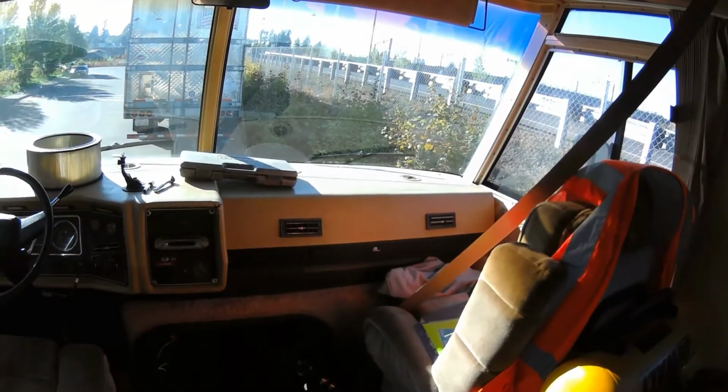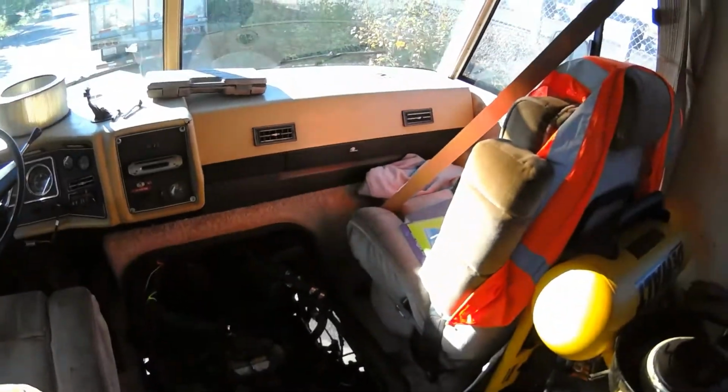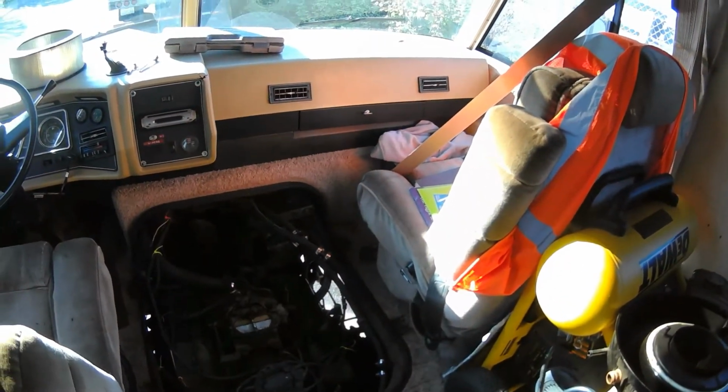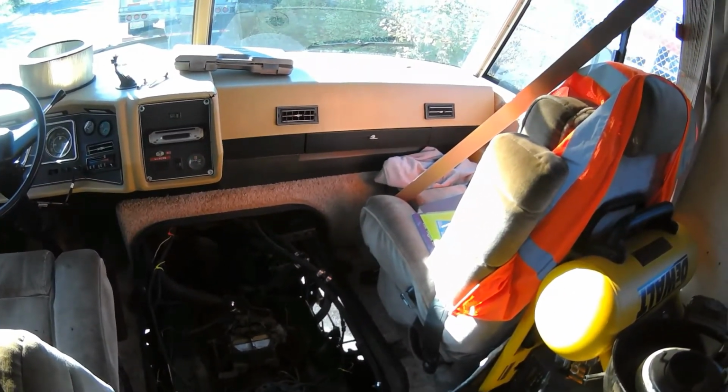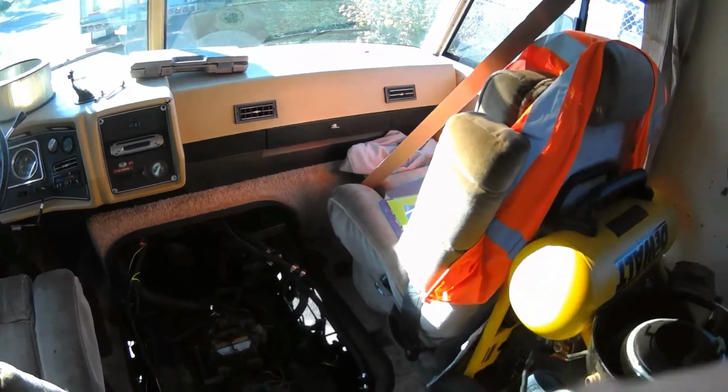Added a quart of oil. I kind of knew I might need some since I think I added a bit more line than what was originally there for the oil cooler. And 7 quarts always wasn't quite enough. It could probably take 7.5. But I put the last quart in that I bought that day because I bought 8 quarts. Got it filled up just a little bit above full line, which is fine.